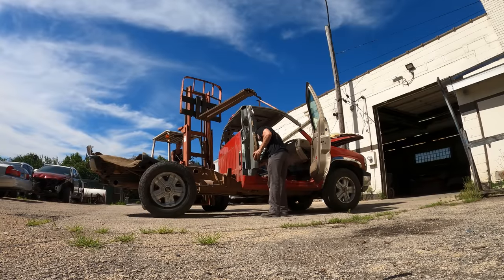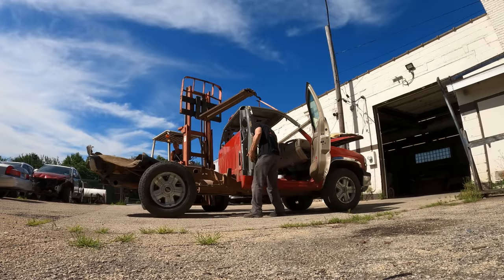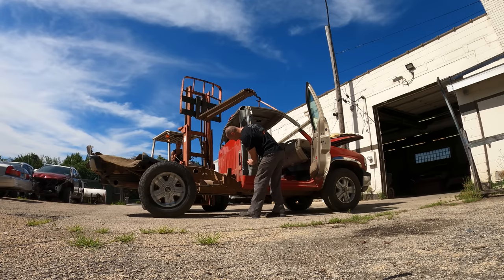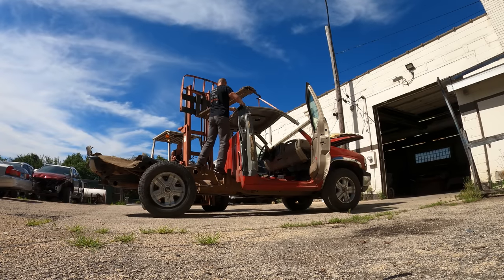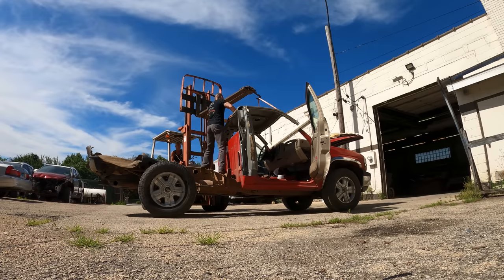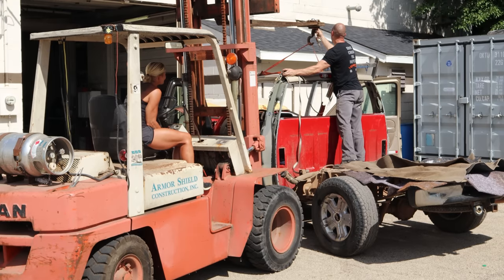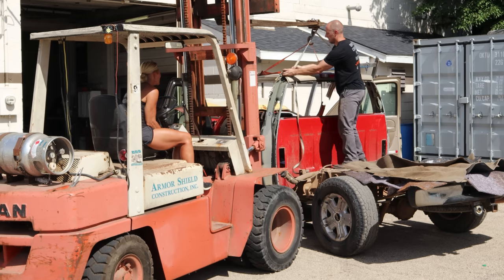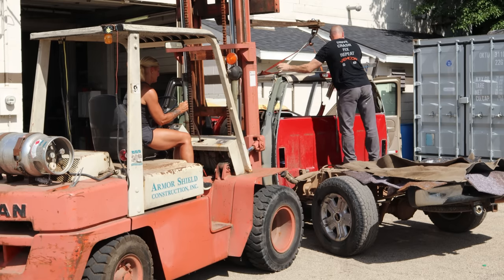We're sliding those B pillar pieces in between our cab panels and it seems to want to go right in — not expecting that. Same thing with the passenger side. Now our bottom pieces aren't lined up, we're going to have to do that now. We need to lift it back up — it kind of fell down a little too far. Not going up, and I just figured out why: our strap came off the back here. So we're going to have to put it on so that it doesn't come off. We'll put it through the eyelet this time so we don't have to worry about it falling off anymore. Just put it on those inner panels and ratchet it up. Now we can lift it again.